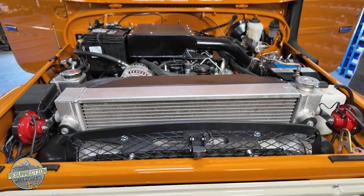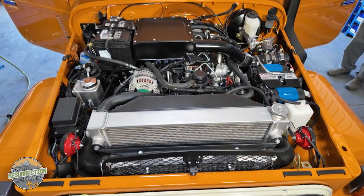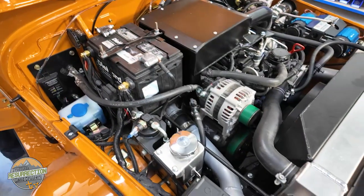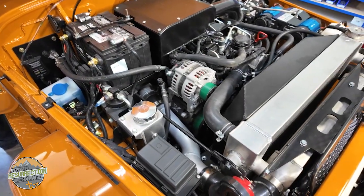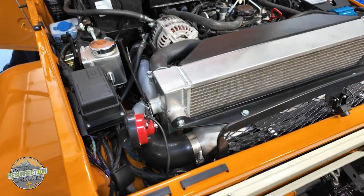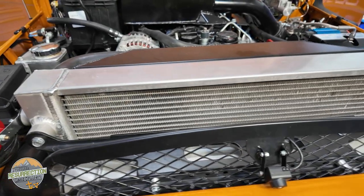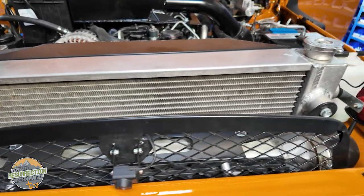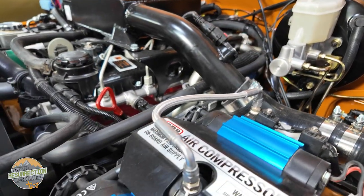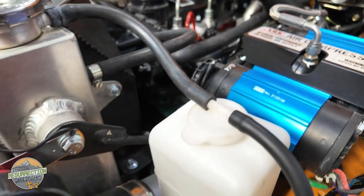Next thing that's cool, the Cummins R2.8. Like I said, the R2.8 is one of the things that we did to this rig a few years ago. This R2.8 is coupled to an H55F 5-speed transmission and a split case. And this time around, we added 3-to-1 gears. I know you've heard me say this plenty of times, but this R2.8 is cooled with our giant cooling package, including a mechanical fan, which is absolutely essential to keep these things cool if you're really using them. Also under the hood is a dual ARB compressor, because this rig has lockers front and rear.